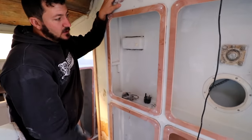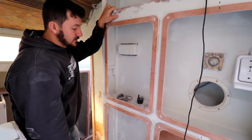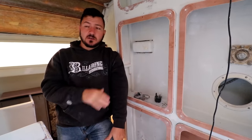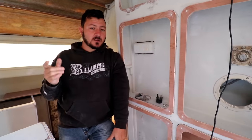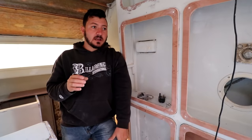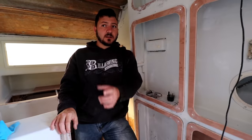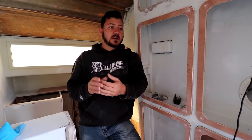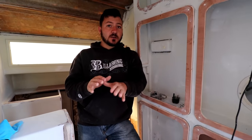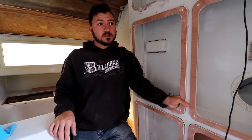Even on the inside of the cabinets I'm fairing down to get it nice and smooth — that's very time consuming. Epoxy primers are the best primers; there isn't a better primer than an epoxy primer, especially with wood in the water. You can get specially formulated Sigma epoxy primers — you tell them what material you're applying to and what you're bonding, and they'll tell you exactly which epoxy primer to coat that material. They're the world's biggest painting company.